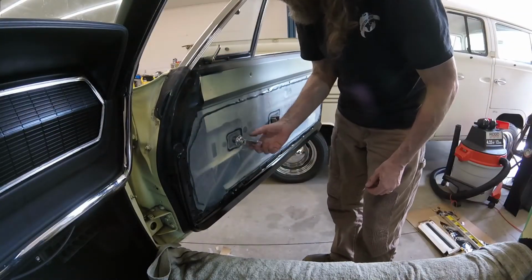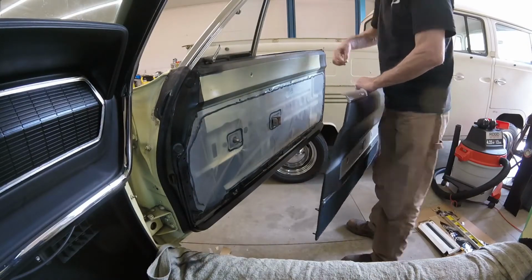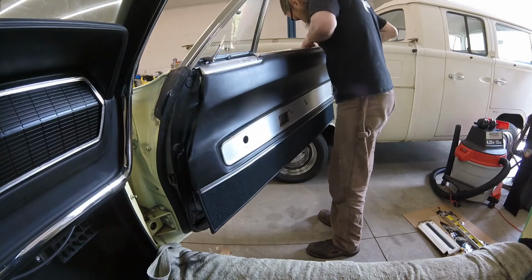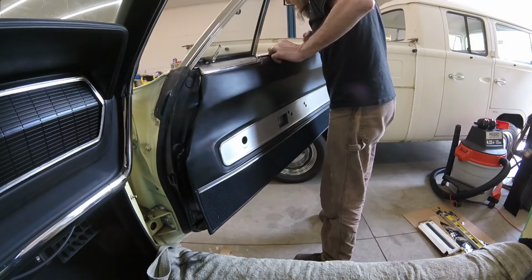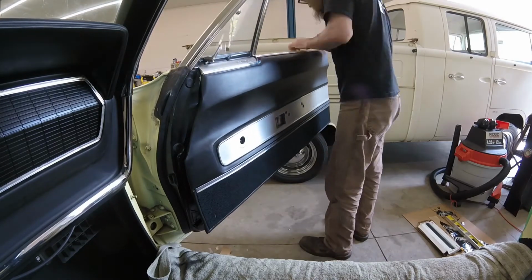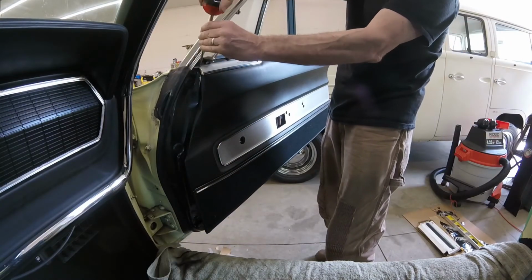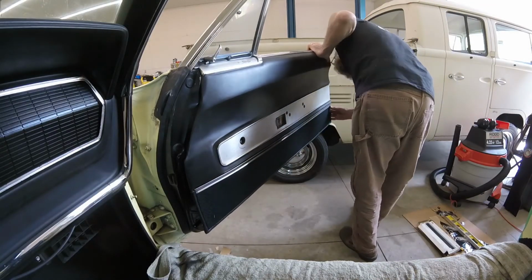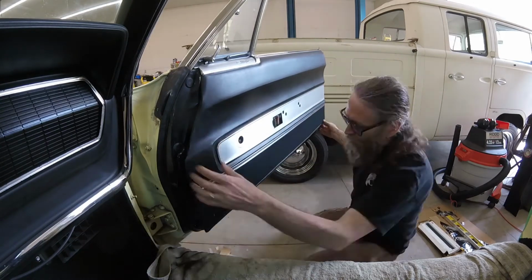Roll down the window, remove the little screw below the vent window, and remove the door lock knob. Hang the door panel starting with the door lock post. Then line up the trim clips with their mounting holes and gently pound them until seated. Reinstall the little screw under the vent window. Carefully line up the panel clips with their respective holes and gently pound them into place.